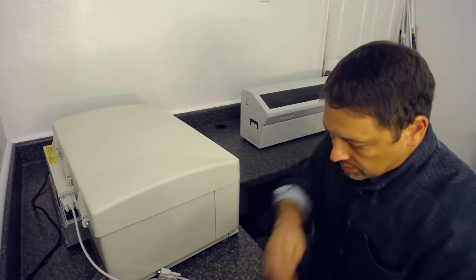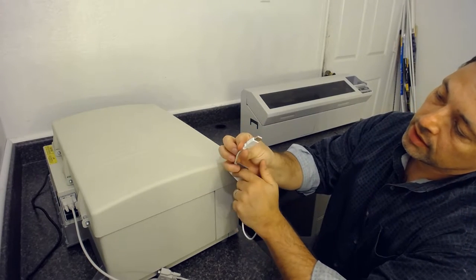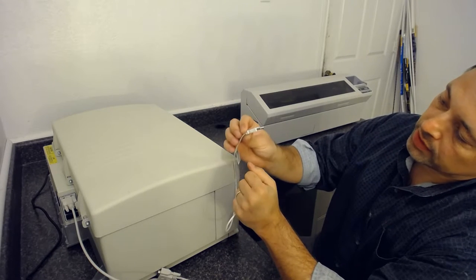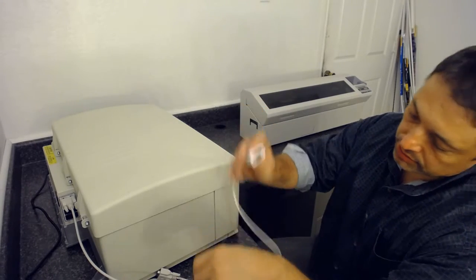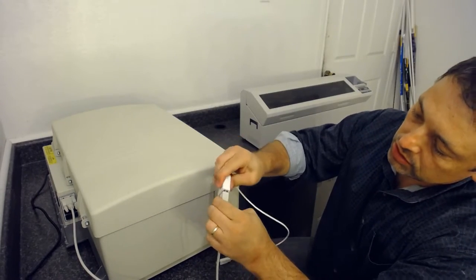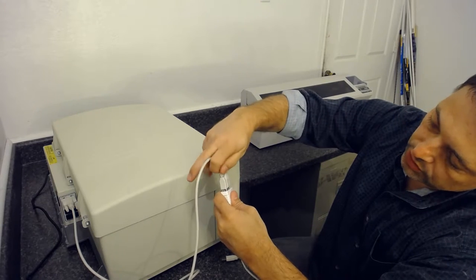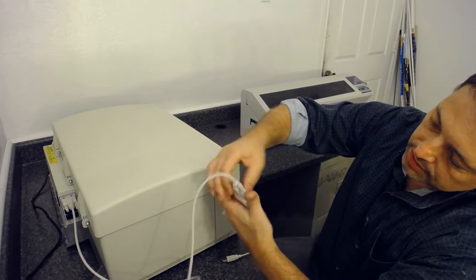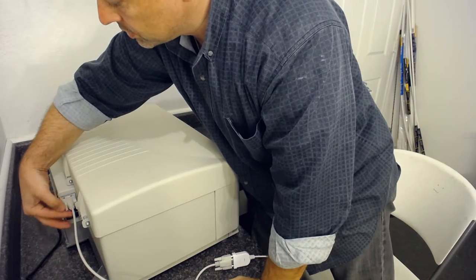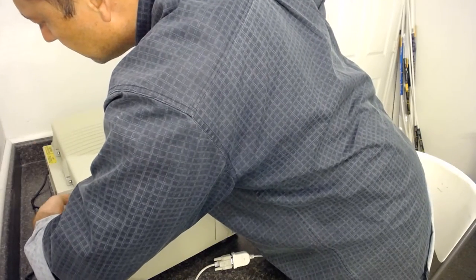Here is the TrendNet TU-S9 out of the package. Your computer won't have a serial port most of the time, especially if it's more recent than the last five to seven years. You plug that into your USB and it gives you your serial adapter end. You'll need a null modem cable, which connects right here. It allows you to lock that down using little screw pins to keep a good connection that doesn't become dislodged. You can do the same on your Datacard — just screw that in so there are no questions about it coming loose.